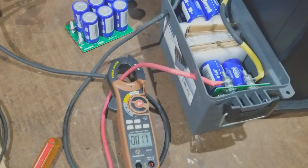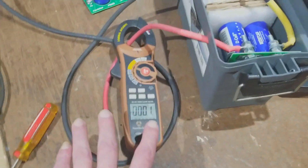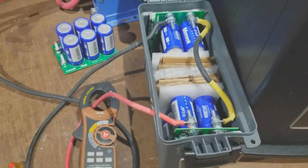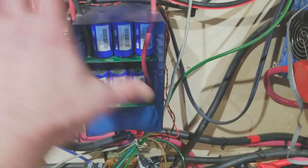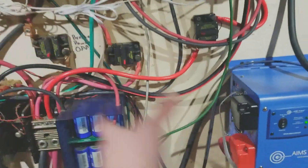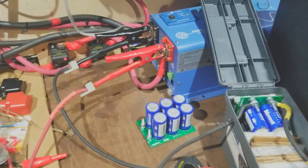I just wanted to demonstrate that for you guys because a lot of you don't understand it. If I had larger loads on this, I'm pretty sure the draw off this capacitor bank would be 10 to 15 amps — it could go up to about 30 or 40 amps; I've seen it happen. That's why I have this little mini bank right here — it stabilizes the voltages for my 24 to 12 volt knockdown and keeps everything powering smooth coming out of there. Of course I've got the larger 250-farad bank connected down to the battery bank.